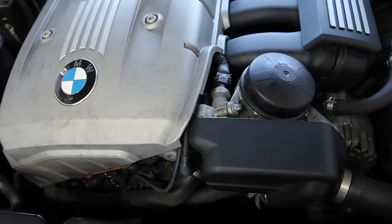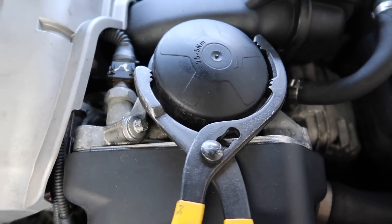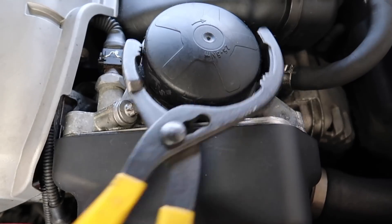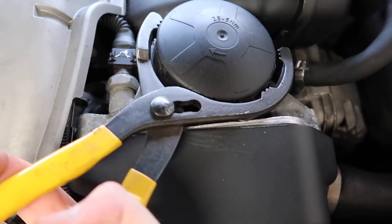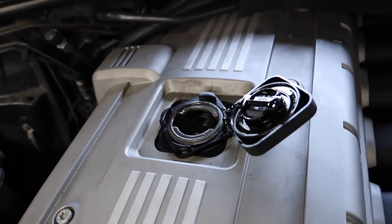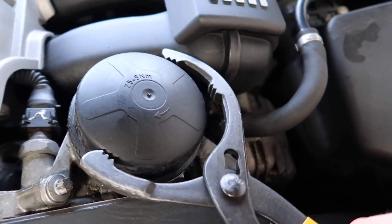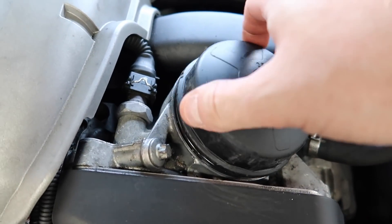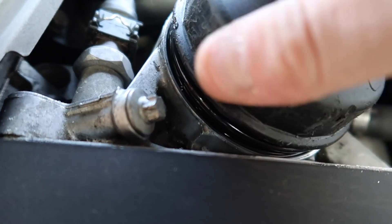I'm going to remove the oil filter cap now. As you can see here, this is the oil filter. You're just going to want to unloosen it — I've got that loosened and you can just let it drain back to the pan. I'll link the tools I'm using in the description below. Just make sure you open it fully and let the oil drain back down to the pan before you go underneath. You can hear the oil pressure dropping back down — that's what we want.